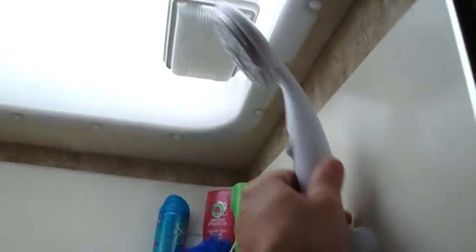And here's the shower. Now I gotta just take this and put it down on the floor. It's got a switch on it. Turn it on. Put it down there. And you turn on the hot water in the shower. Oops. Switch is pointing the wrong way. There we go. And as soon as that water starts running pink, then we know that we've got antifreeze through there. Well, lots of pink water there.